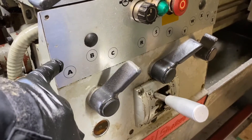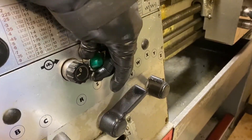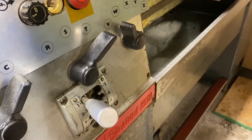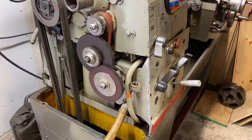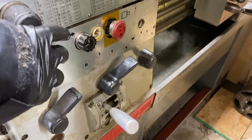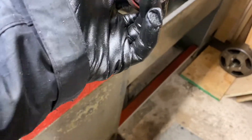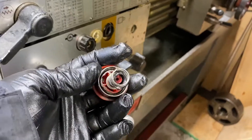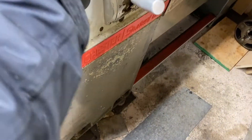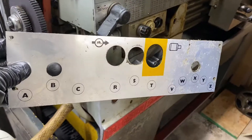Four tiny little phillips screws or star screws - take this plate off. Going to unscrew this, the indicator lamp, for it to come forward. You have to unscrew the ring on the stop to get this plate off. Unscrew it and it will pull - just be gentle with it, but you have to unscrew it. It will pull to come out. Just be gentle and then theoretically this plate comes off. This face plate will come off but you do need to take this off.